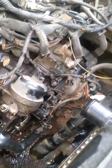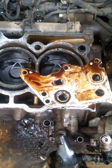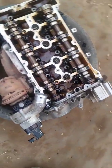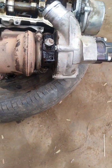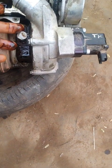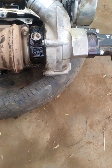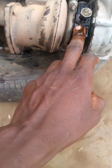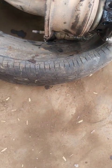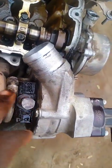We also need to look at the transmission oil cooler, since it's difficult to pinpoint exactly where the mixture is happening. Another suspect is the turbocharger — I've never come across a turbocharger doing this before, but both oil and water flow into the turbocharger, so if it's the source, the mixture would be happening there before coming out through the lines.